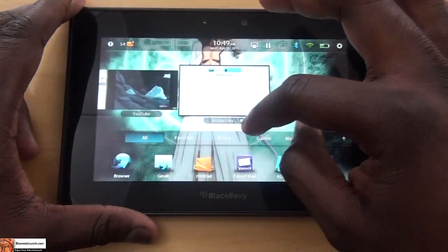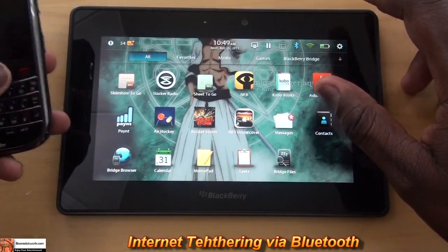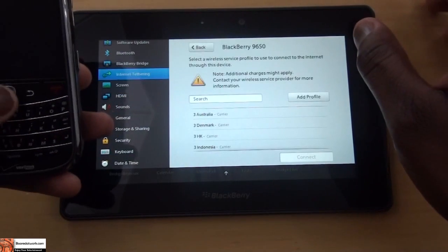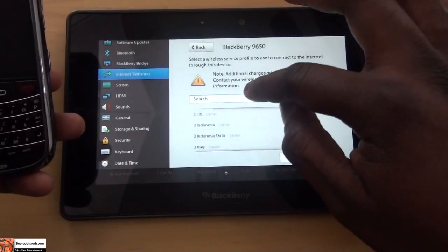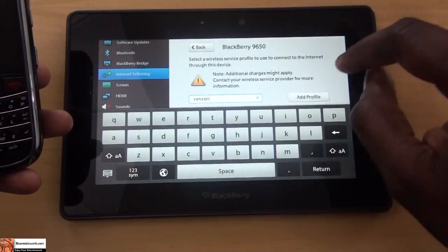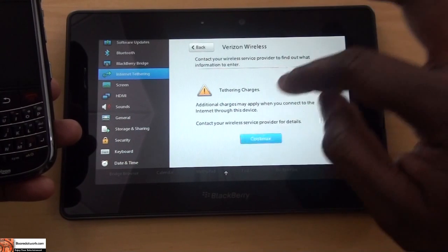I have a messages icon that brings it up, so I can pull and look at messages. If I go into bridge files it brings up the bridge files. The calendar shows up as well. So this is BlackBerry's secure way of bringing all these files across. There's some crashing, just showing you how things are linked. We can also show you how to use Bluetooth to tether internet connectivity, so I'm going to turn the Wi-Fi off. Go to internet tethering, Bluetooth, show internet, select a Bluetooth device — I selected that already — select the wireless profile.